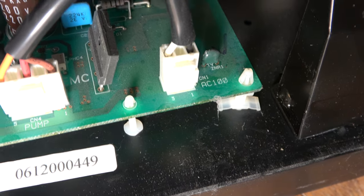That's why I'm happy temporarily to put a 5.6 volt diode in there until I can get the correct one. You know, it's a bit of a marginal component, and I'm sure the system would work fine without it. But let's fit the diode I've got, and then I can reassemble it all and test it. Right, I'm going to refit the main board temporarily. I'm not going to refit everything because I still need to change that diode for the correct type. But for now, we can pop this in and test it.